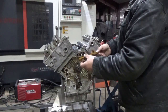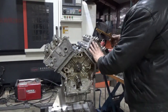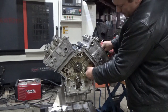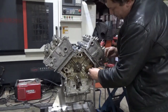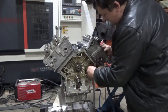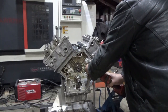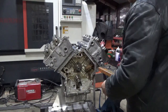We'll start with the nylon timing chain guides. This is the left bank, this is the right bank. We'll take the left bank nylon tensioner and slip it in. We'll put one of the shouldered bolts in at the bottom and use an impact to quickly drive them home — that's not to be confused with torquing it down, it still needs to be torqued afterward.